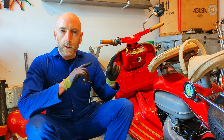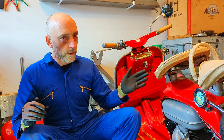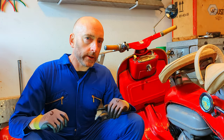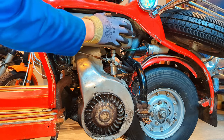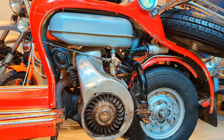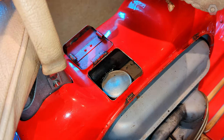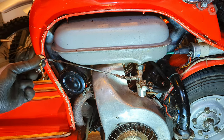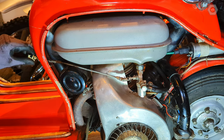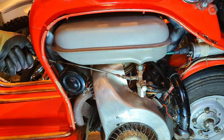I love air-cooled technology and I love two-stroke technology, but I've never worked on a scooter before. So if you are a Vespa or a Lambretta fan, please allow this indulgence. Firstly, we have a gravity-fed fuel tank at the very top — that's great news, it means no mechanical or electrical fuel pump to worry about. It's pre-mixed two-stroke, meaning the engine oil is already in the fuel, and that means there's no oil injector pump to worry about either. We turn off the tap and it stops. Fuel is supplied by force of nature with no moving parts — simple and reliable.